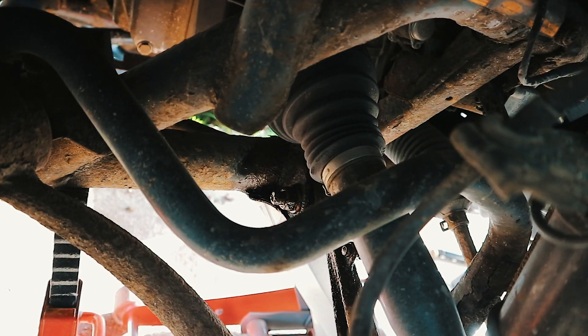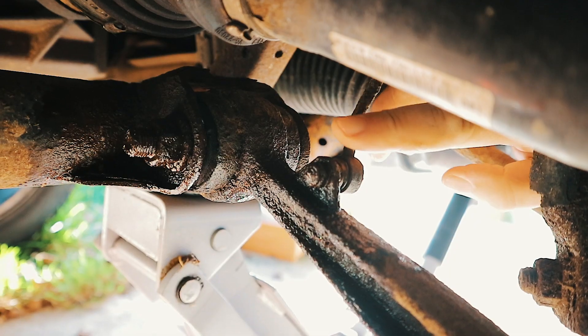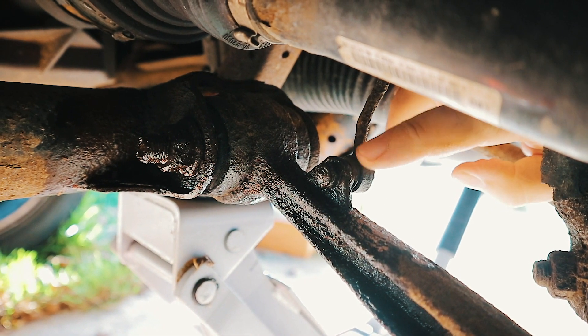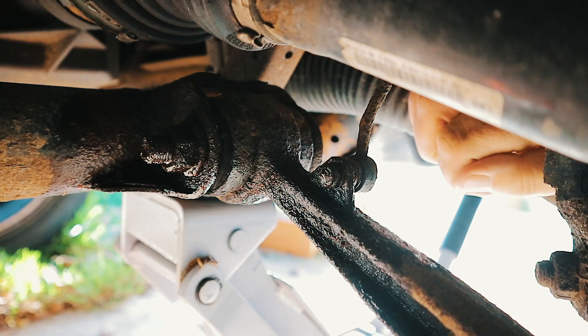So next we're going to jack it up, get the wheel off and see what we can find inside. Right, so we've got it jacked up. Safety first — always use axle stands, jack stands. I've got a two-and-a-half ton trolley jack and I've got two three-ton axle stands. They're a bit overkill because you're not holding the whole weight of the vehicle, but they're plenty strong enough and we don't want the thing falling down on us. I've wire-brushed off the threads and given it a good squirt with WD40. I've also given the height sensor a good soaking of WD40 and we're just going to let it sit and let that penetrate the threads.